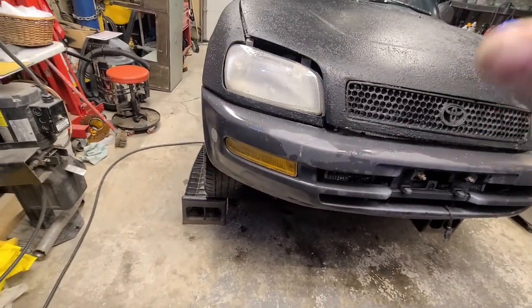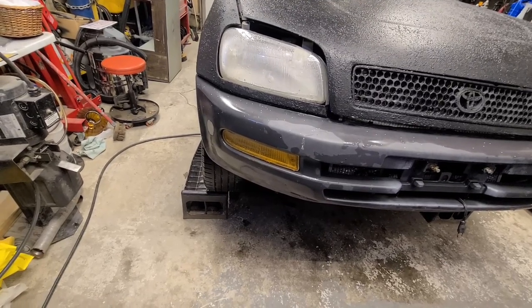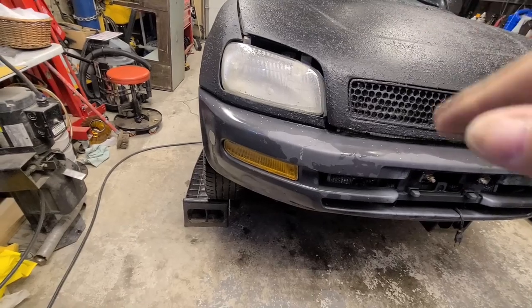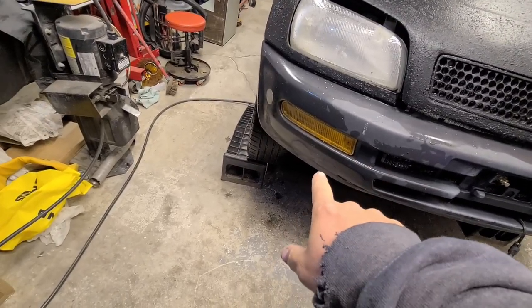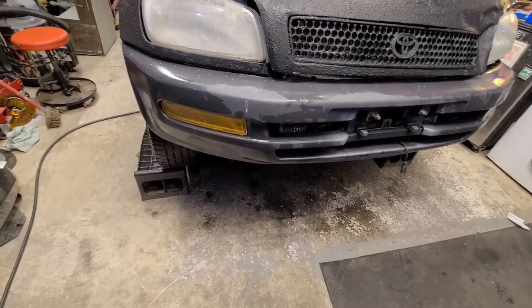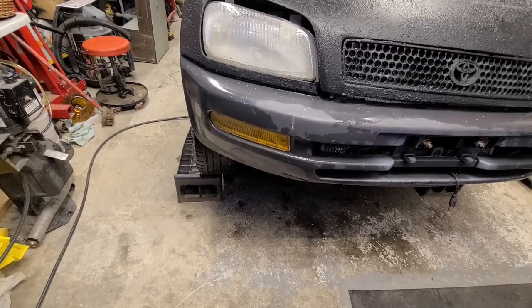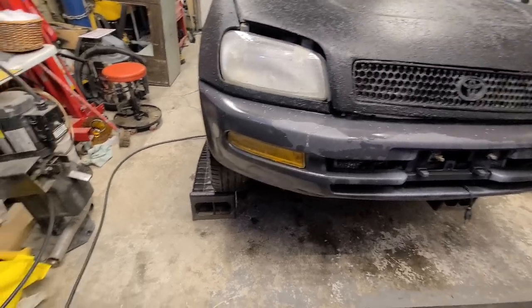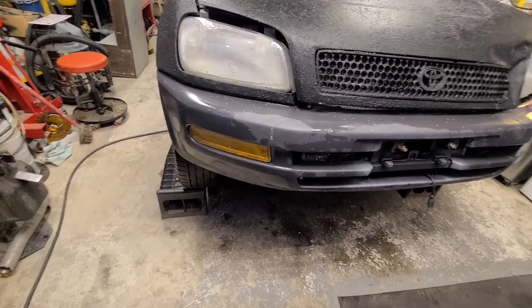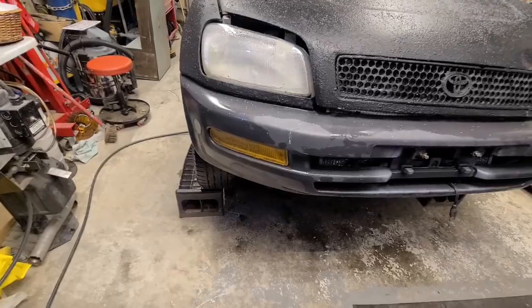I hope it's not the seal. There's an oil seal for the oil pump that's above and behind the timing belt cover. There's a seal in there — it's like a rubber thing — that goes and then drips. But I was looking at it the other day and it looks like it's dripping from the oil pan consistently. There's an exhaust that runs over the oil pan, so I'm just gonna JB weld that little hole — maybe. Well, it's not a hole, it's just the seal's gone. I don't feel like really pulling the oil pan. I'm gonna wire wheel it, put some JB weld on there — it's just a little drip, so it should hold. JB weld is king.